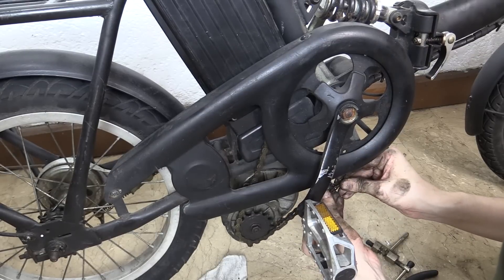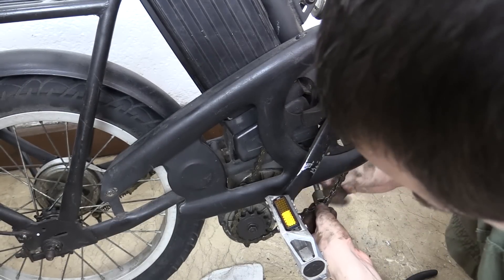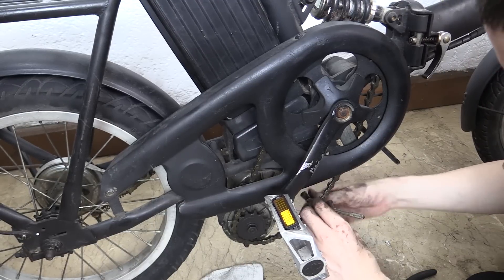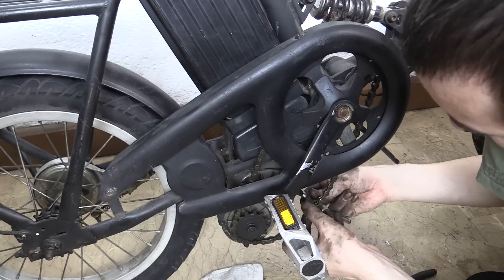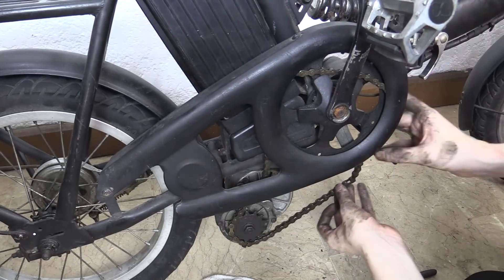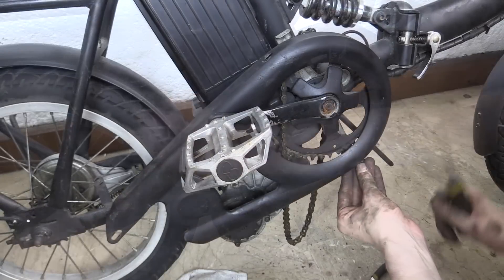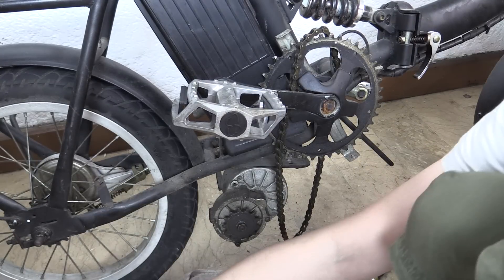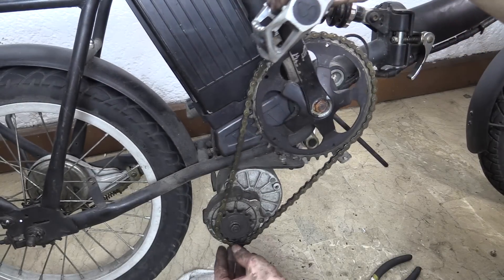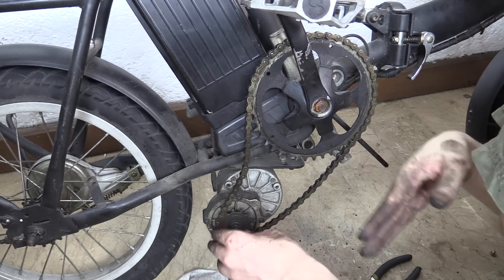Now we've got the chain roughly to the length we want, and we've got to try and reconnect it. Let's try and push the pin back the way it came. This is a little bit time-consuming — by the time I edit this it's going to seem really quick for you, but for me I've spent quite a lot of time on this. It's not perfect, but let's at least give it a go. Let's remove the chain guard because it's just getting in the way. That's much easier — should have thought about that in the first place. So we've got the chain on, we're turning the motor, but it's not staying in line. I don't know if it's because we've got too much slack or if they're just not aligned enough — I think the slack might be the problem.